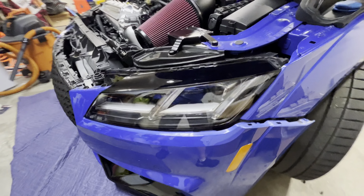That was really easy — it pretty much slides right off. There's one clip down here you have to undo: slide the red tab back, squeeze, and pull out. I put a moving blanket underneath so the bottom of the bumper doesn't get scratched. I also removed the headlights. To do that there's a bolt here, a bolt here, a bolt here, and you have to remove the plastic bracket which has two T30s holding it. You then unplug it — this side also has a plug up towards the front.